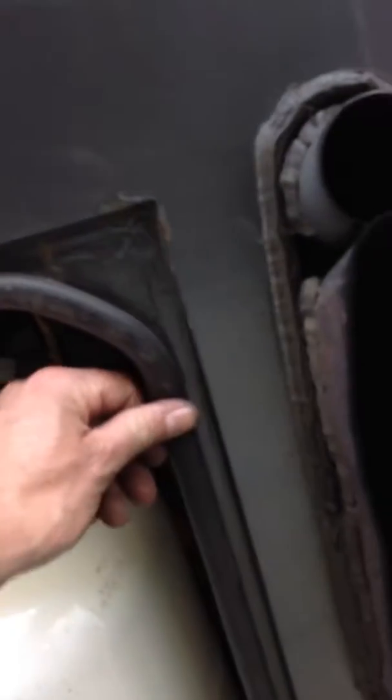These latches on the outside of the bus need maintenance once in a while. You're going to want to lube these latches and make sure that the jam nuts are tight and adjusted properly. We want these to be fairly tight, and it does take a pretty firm push here — push in with one hand and then turn with the other. Don't force them. When you open them, push and relieve the pressure so that it turns easy. If it's not turning easy, there's a problem — you've got to push in and relieve the pressure of the weatherstrip so that the latch will turn.